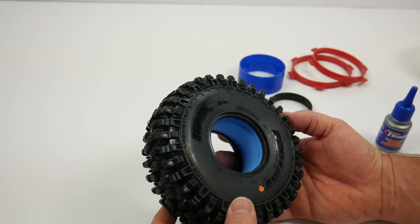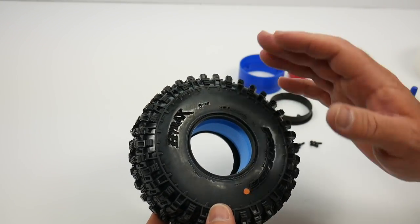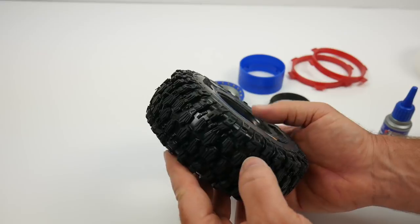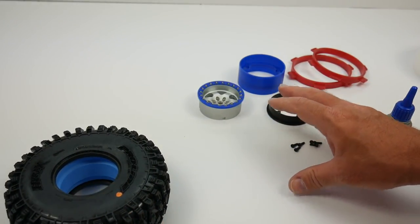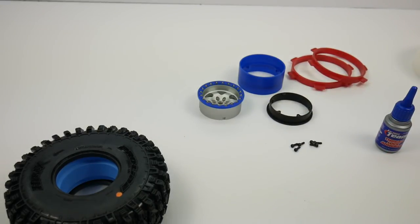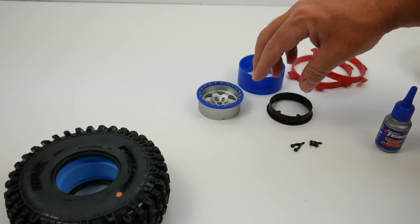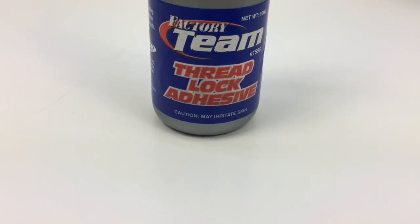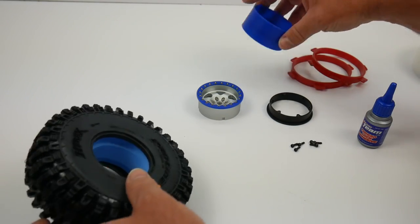I gave the Hyrax tire and dual-stage insert a once over, making sure everything was symmetrical and perfectly balanced as much as you can to start out building the wheel now inside of the tire. Right here I went ahead and disassembled my SSD RC wheel. Your wheel may vary, so definitely check the manufacturer's suggested install method. We have the inner ring, the outer portion, the inner portion, and then finally some screws. I like to use Loctite on all of the screws going into aluminum — just keeps them safe, especially when you're out on the trail.